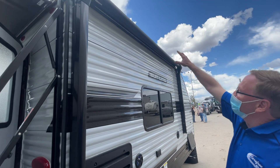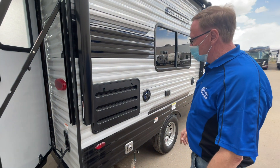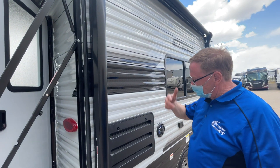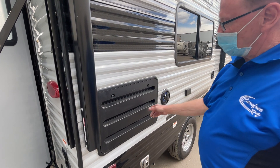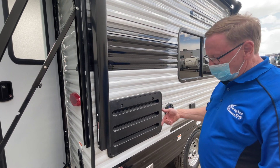On your side, once again we have another awning here. So you have the luxury of having two awnings with this particular trailer. This is your fridge vent. There's also another vent on the roof. The air circulates and basically all you have to do is just take off these two screws with a flathead screwdriver and air compress this out, because you don't want that dirty air going into your refrigerator.